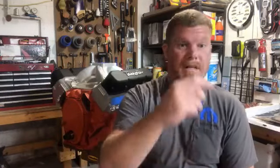Okay, here's a good example. Great example. Yamaha SVHO says, hey, listen, to get optimal performance, and these are their words, to get optimal performance out of your SVHO, you need to run 91 to 93 octane. All right? But if you look at the manual, it says you can run 87. You're just not going to get optimal performance.